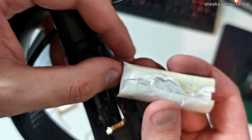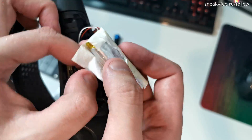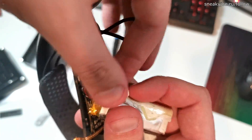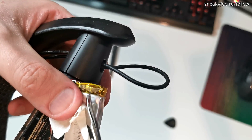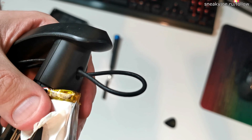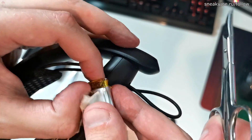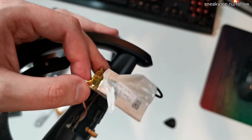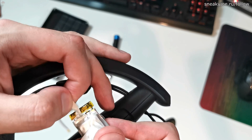After all the struggle, we need to do one more thing with the original battery, which you can skip, but I'll still show how it's done. I'm going to harvest the original battery management system, or BMS. For this, you need to unwrap the paper cover — who the hell thought that this is a good design? Then, you will need to open the Kapton tape using manicure scissors, trying to be extremely careful where you cut, because if you damage the battery housing, you can die — which I almost did here. But finally I have some success and am almost ready to harvest the original battery management system. You can bend the battery legs a bit, and now you can take a look at the BMS itself.